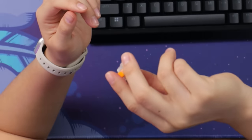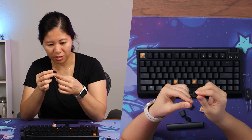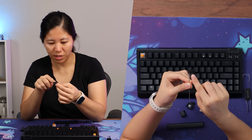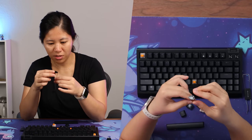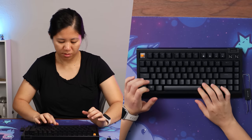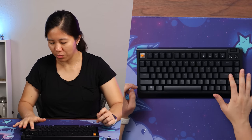You've got this diffuser dome that you see in most Razer switches. It's a tactile switch with a nice bottom-out sound and doesn't really have any pre-travel before you hit the bump. Even if you're tapping lightly, you're still going to hear the bottom-out. Because it's a gaming switch, they only made the actuation force 50 grams, so it's pretty lightweight. The stabilizers are plate-mounted and pre-lubed — a very clean application with lube on the housing and the right-angle bend. No ticking, maybe a slight bit on the Enter. Nice.